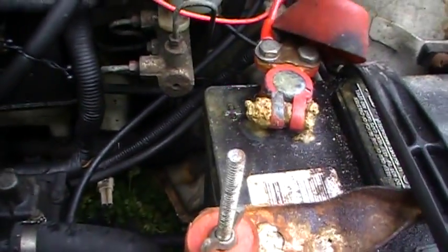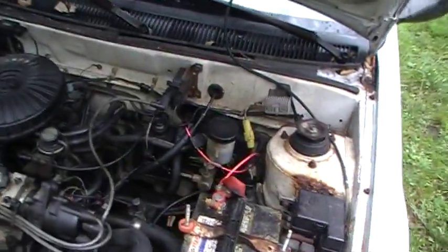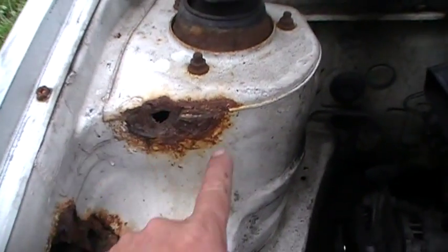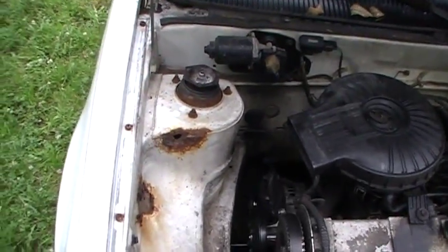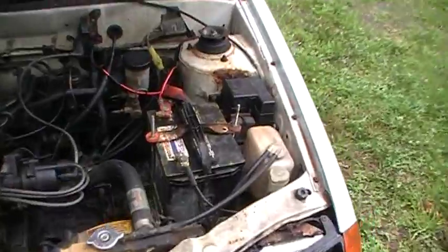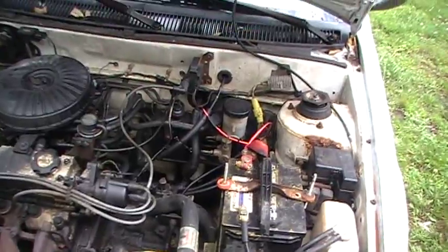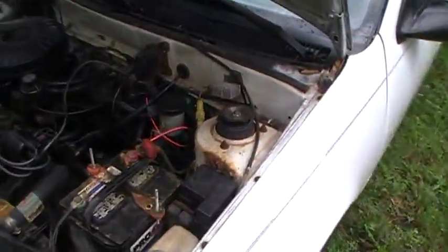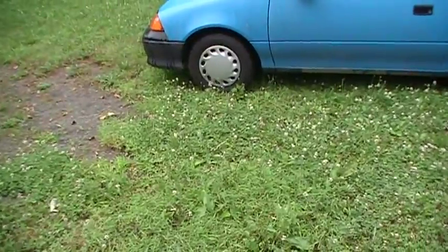You got to get in there and hammer on them to tell. What I did on mine, the 92, they appeared perfect too. Then I hammered on them, and on the driver's side I poked 2 holes about finger hole size, in 2 places, and then I stopped. Then I poured a bunch of rust stopping acid, kind of rust converter, up inside there, and then a couple days later I used 2 entire cans of Rust-Oleum primer and just sprayed the hell out of the inside of the horn on my driver's side of my 92 just to get it to stop rusting, because I think the little bit that it did rust isn't going to hurt it.